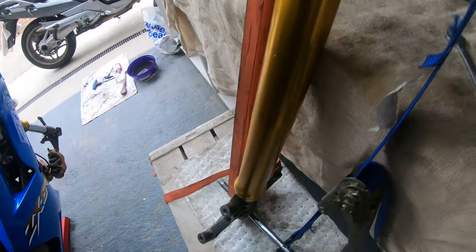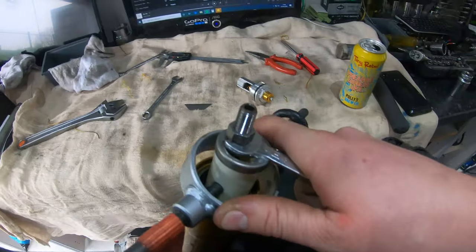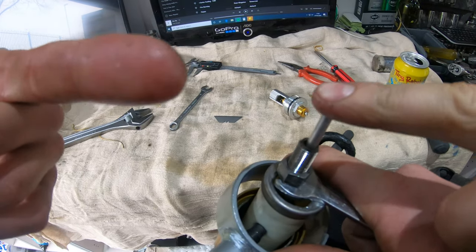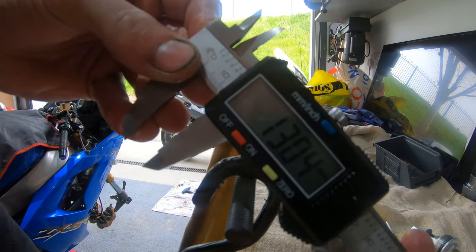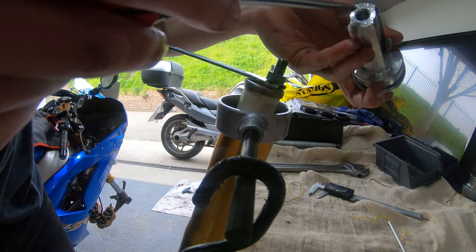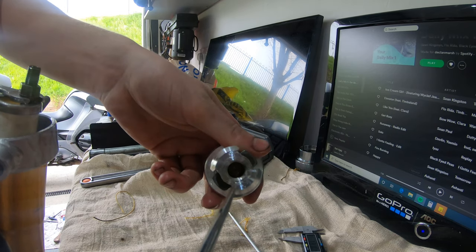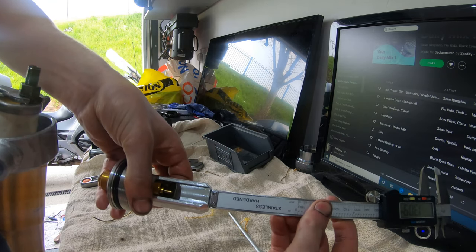Retighten your ratchet straps and then place your spanner back under the compression rod. Place the dampening rod in the dampening rod tube. The stock dampening measurement is 13 millimetres. So as long as the locking nut is below 13 millimetres, when we adjust the dampening adjuster to about that it should fit on nicely. You've got to adjust this with a flathead so that the distance from the top to the bottom of that flathead bolt is 13 millimetres. Then you can screw it onto the top of the dampening rod.